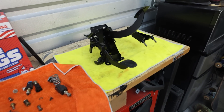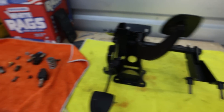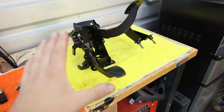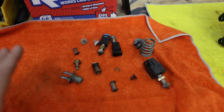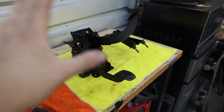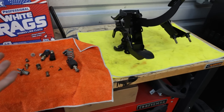The first thing I want to start with today is getting our pedal box reassembled. We did delete the OEM accelerator pedal and we are using a drive-by-wire pedal with an iWire bracket — that's an 07 STI throttle pedal with iWire's bracket. But we still need our clutch pedal and our brake pedal. It's been a little while since this was taken apart, so I need to reference photos to figure out how to put it all back together, then we can get that installed with our freshly Cerakoted brake booster.